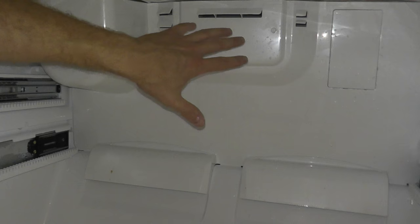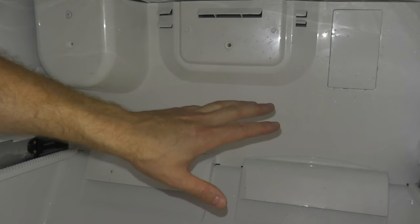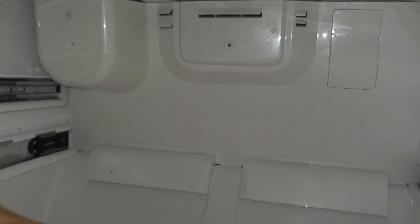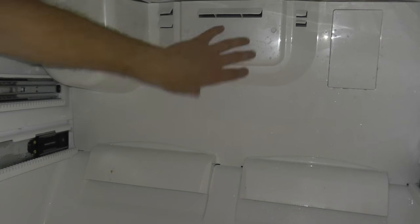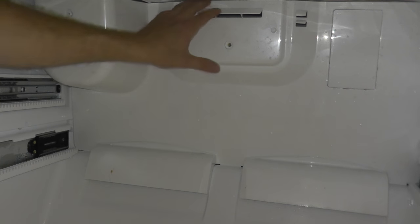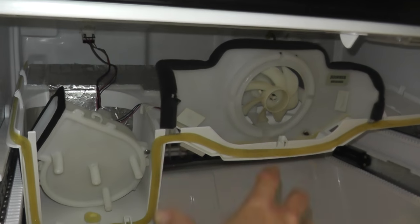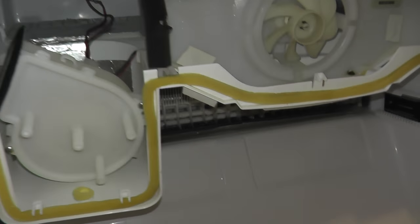Very quickly — nothing is running right now because I turned off the power to the fridge. I didn't want to pull the fridge back out and unplug it, so I just turned off the power. There's a fan right here, so you want to turn off the power before you stick your hands back here. I essentially just peeled back the panel and it's just sitting on top very comfortably. All you really need to get to is right here — as you can see there's a lot of freezer buildup, and I'm just going to clean that out with some very warm water.